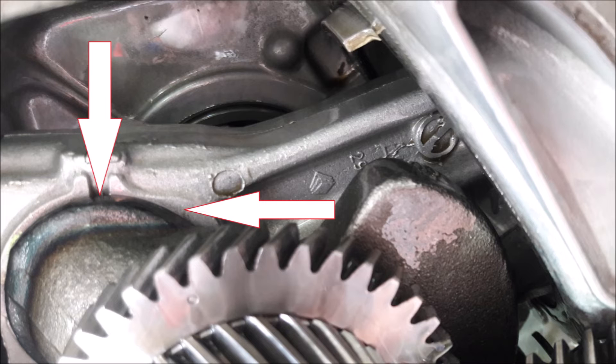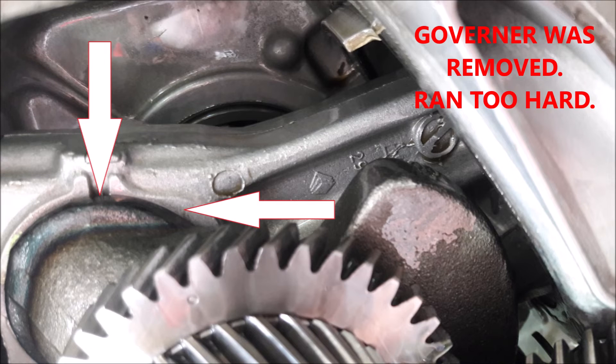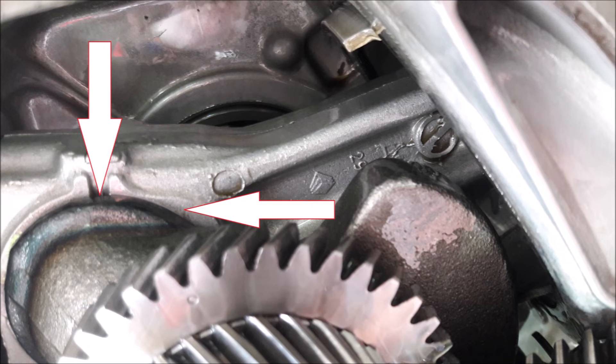The next step was to take off the shaft cover, and as you can see in the picture, the rod has some discoloration and there was definitely a little too much of a gap there, which is what's making the knocking sound. That's a whole other video within itself, so we'll end it here — see you next time.